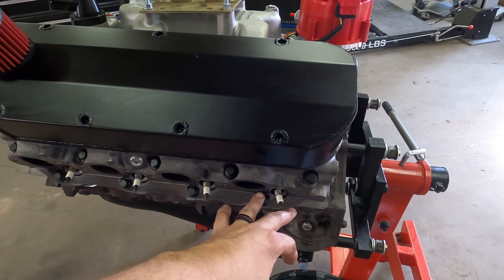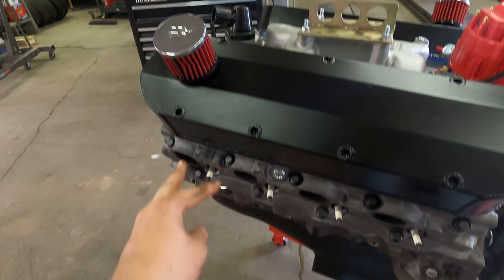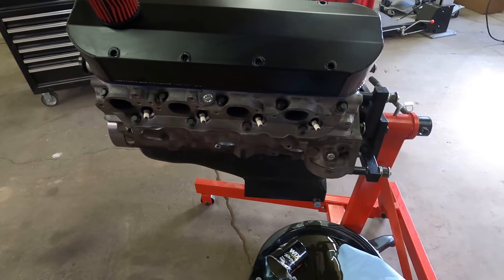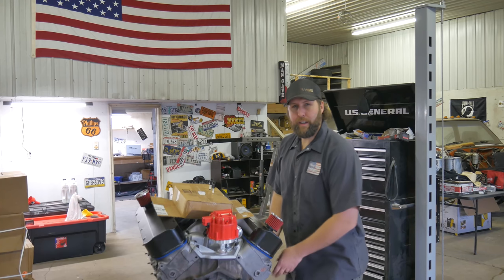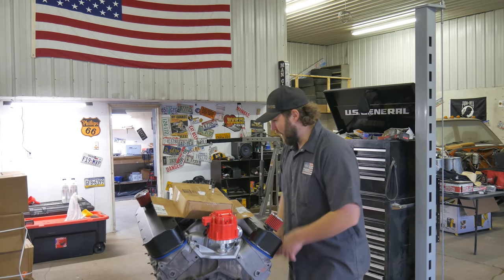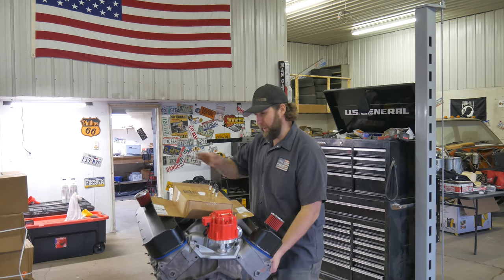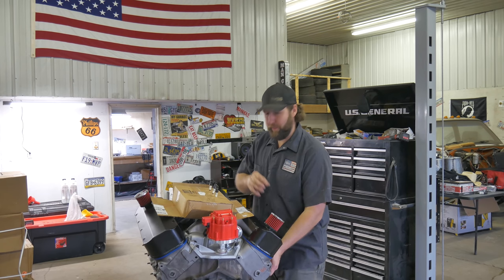Let's pull these out and read on them. Then we'll put the little digital camera probe down, take a look at the cylinder wall, see how those are looking. Got my custom spark plug holder XL200 out, and that'll just sit up here and I'll plop these in. That way when I get all these out, we can look at it and see if anything is different by cylinder.